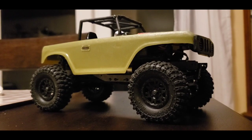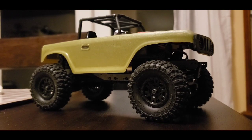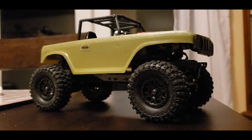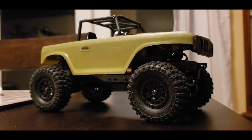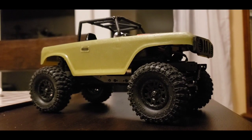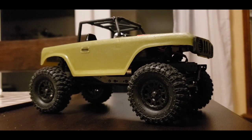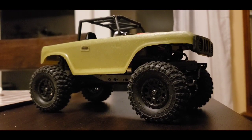Today's test went kind of like I thought it would. I just don't think that stock plastic wheels have enough weight to keep the nose pinned down when you get into a high angle incline and start putting torque behind it — it just wants to flip the truck over backwards. So with the SSD rims on tomorrow with the brass insert, it should be a different story. But today just shows you what plastic wheels can do, and it's not much compared to what you can do with metal wheels. I'll get that taken care of tomorrow afternoon and take it back to my dad's course, and we'll see how it does with some real rims under it.